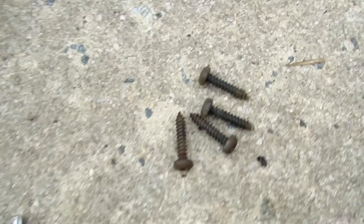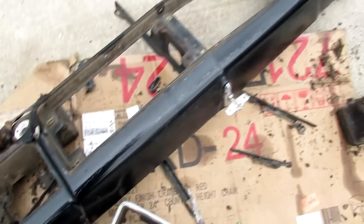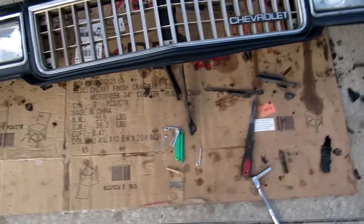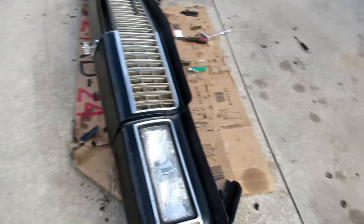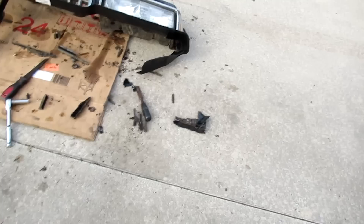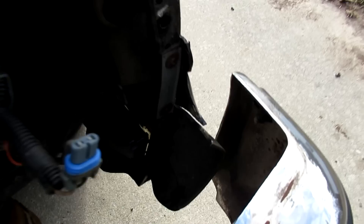You're going to have to remove this stuff. It's going to look like this - the bolts are going to be on the inside of the bezel: one, two, three, four. Take that out. I'll be back when I put all this stuff together. I'm going to wash this stuff real quick - it got a lot of dirt on it. So let me clean it out real quick. I got everything put back together. Got the bumper fillers on. Had to spray a couple of things out - it was real dirty. As you can see, the bumper fillers is on. Just got to put it back together on the car. One more thing - see the side piece right here on the side. They go right here on the side. I'm going to take these bolts out. Three bolts that need to come out. On both sides.